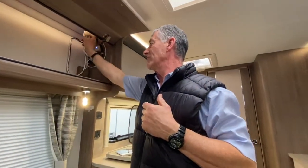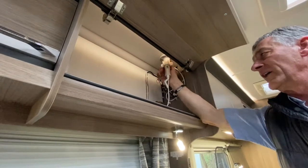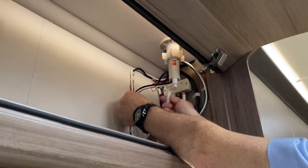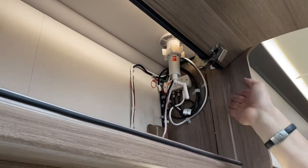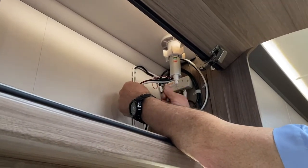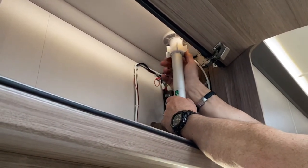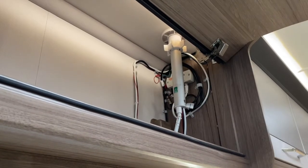When you come to transit, go back into transit position. So you finish using the television, turn off the booster box. In certain areas you can change the pitch of the aerial from a horizontal plane to a vertical plane. You do that using this crank handle, and you can see it's changing to a red V indicator — that's the maximum. So that's changed the plane from horizontal to vertical. In certain areas within the UK, you find better reception on the vertical plane — just try it, or if you see others using vertical, you know to match that. Back to horizontal, and that is the transit position: bring the pole completely retracted. It won't retract fully on vertical, so make sure it's in the horizontal plane. Tighten up the lock nut to stop it lifting in transit. That's the aerial system on this particular caravan.